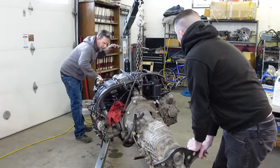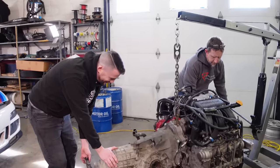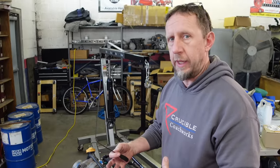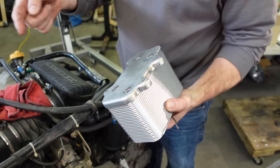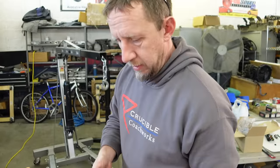Oh my gosh — power steering fluid leaking out? No, that's coming out of the cooling system. That's why we're going to do the other fun part of this video: flush out the coolant system. So the issue we were dealing with was an oil/coolant intermix. We were really fortunate that the problem was just the oil cooler. A lot of German manufacturers use these — oil goes in one side and out one side, coolant the other way, and it lets the coolant cool the oil. The problem was the old one had failed internally, so oil was going into the coolant. We replaced it and our problem is gone.